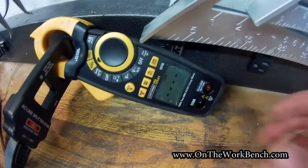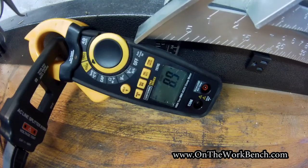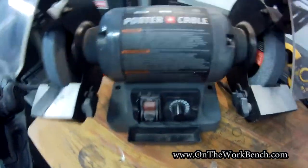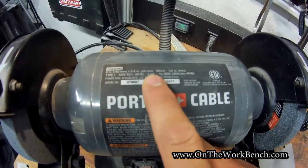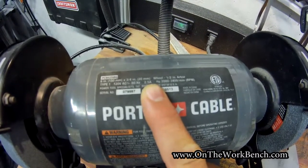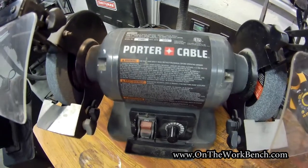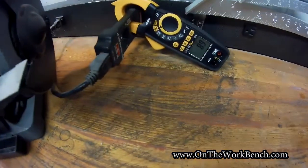So we're on inrush mode, and activating the bench grinder — that's particularly important when you look at what this bench grinder is rated for. It's rated at 2.5 amps, but the meter shows it's definitely drawing more than that. On startup, we're seeing about 8.9 amps of inrush current — that's how much it needs for the initial motor startup. As you diagnose electrical circuits, you'll want to look at these different amperage specs to identify issues like extra resistance creating a change in amp draw.